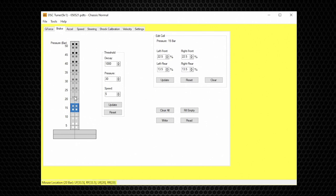In our standard calibration files the brake table settings are tuned very well, so typically you would not want to change these. With the additive value, you cannot exceed 100% output — 100% is the maximum. So 60 plus 60 still caps at 100%, but what this does is achieve 100% sooner. For anyone with shock tuning experience, it's all about timing, so achieving the max value sooner is a big advantage.